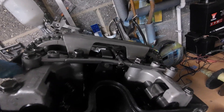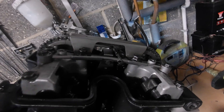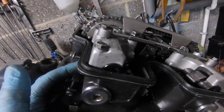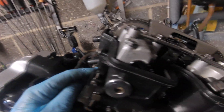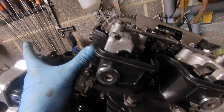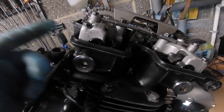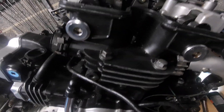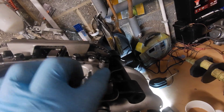This engine has also had — I can see what you're seeing there. When the oil comes up the pipe in here into this cap, these caps have got a tiny little oil hole that's actually been slightly enlarged. So it allows more oil coming up here — if you get more oil up those two pipes but it meets a tiny little pinhole, it kind of defeats the object. It wants a volume of oil up here as well as pressure.